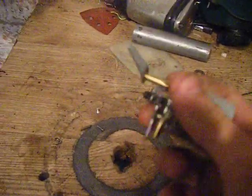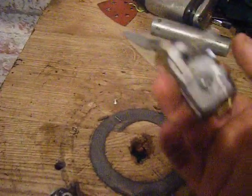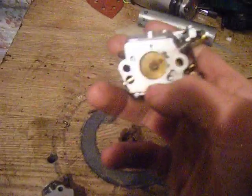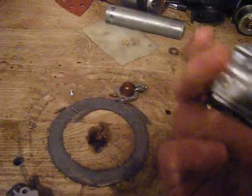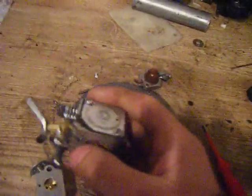There's the choke. I was going to take it apart and show you it all, but I'm not going to bother. When you have one of these carbs which works — if you get a new one and it works and you just want to give it a clean out inside — don't. Because the chances are, once you take it apart, no matter what you do, once you take that apart you're going to need to replace something inside, like a diaphragm. This one needs the big diaphragm at the back. The small plastic diaphragm in here — that one's good, but the one here is wrinkled.